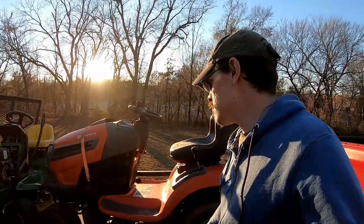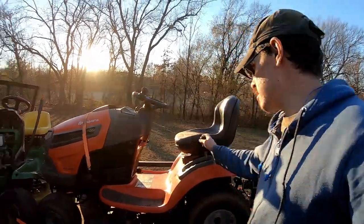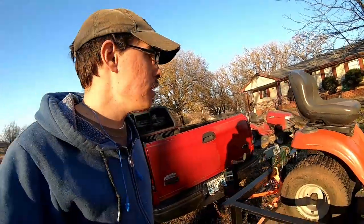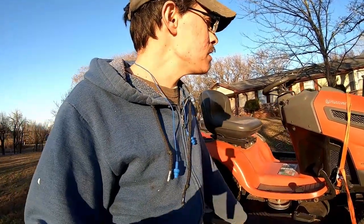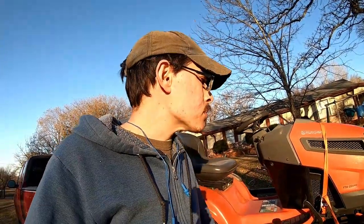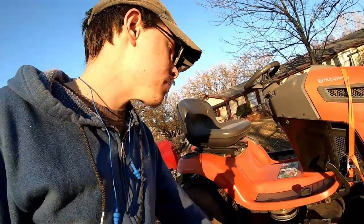The other day we picked up these. This one's actually pretty nice — it's orange. In all seriousness it looks like it's pretty clean. From what the previous owner told me, it may not be a major fix. He said it stopped running mid-season and he found gas in his oil, so he's thinking the engine needs to be torn down. I'm thinking if it's just gas in the oil and it wasn't run like that for too long, it could be a really simple fix — fixing whatever caused the gas to get into the oil, which is most likely a carburetor issue, and changing the oil out, and it could be good to go.